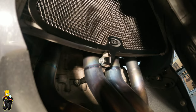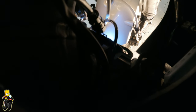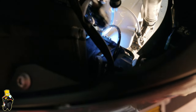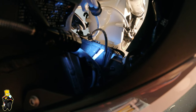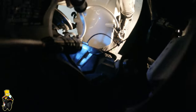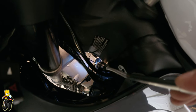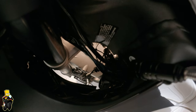We'll do the zip ties at the top before we tighten that all the way down. This piece here is the top of the radiator guard — that's where I'm going to zip tie it to the bike, probably right here. I'm going to do the same thing on the other side. On this side I used where the horn is mounted and I just used that to mount to the radiator guard.